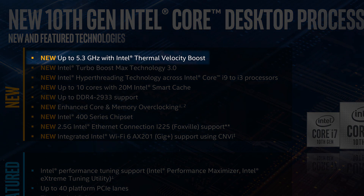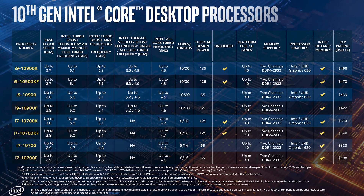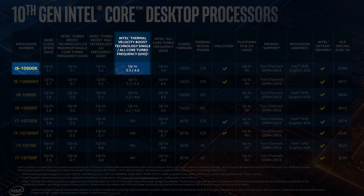This is important for Intel because their marketing machine has been really pushing their Thermal Velocity Boost feature on the i9 SKUs. For example, the 10900K, under the right thermal conditions provided that you have a beefy enough cooling solution, will allow it to enable PL2 and boost all the way up to 5.3 GHz single core and 4.9 GHz all core.